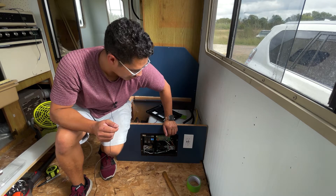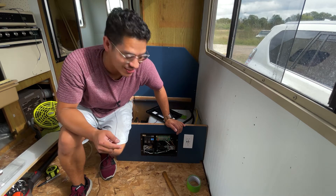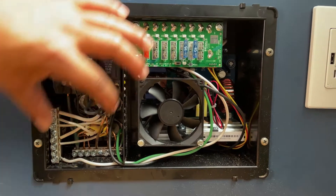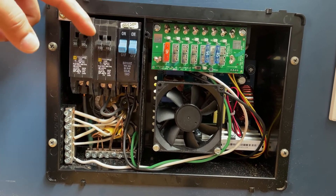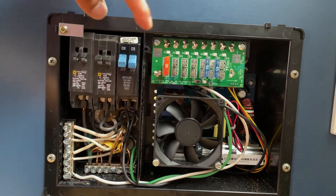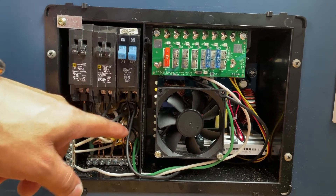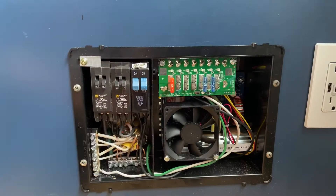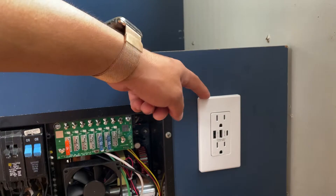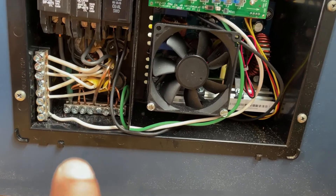I finally installed the PD 4135 — it was a tough job but I didn't shock myself, so I'll give myself that. Wiring everything back was pretty easy; the hard part was making everything fit in such a tight space. Because I numbered everything before, putting it all back was much easier. I added some new breakers — a 30 and 20 tandem instead of two singles. The converter now has its own dedicated breaker instead of being combined with an outlet. I also added another outlet connected to the new unit so you can charge laptops and phones.